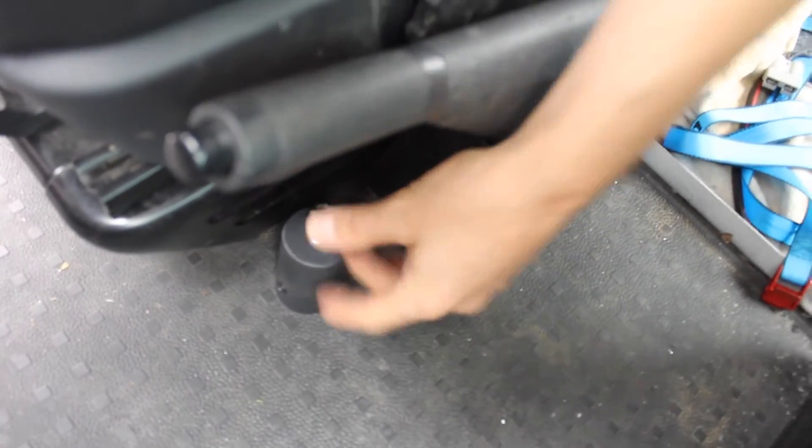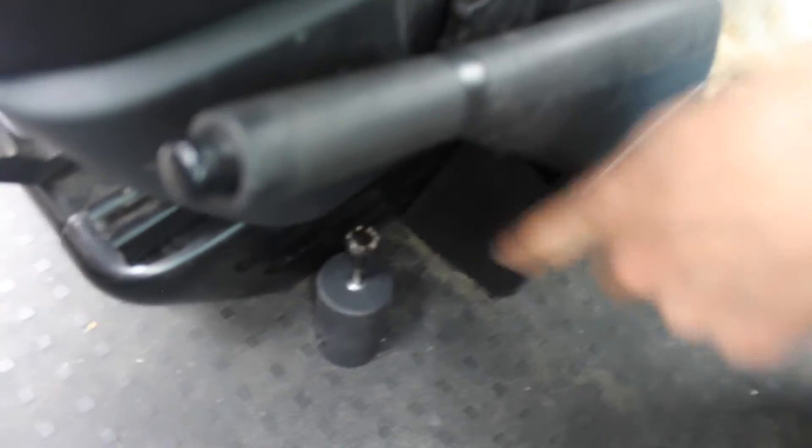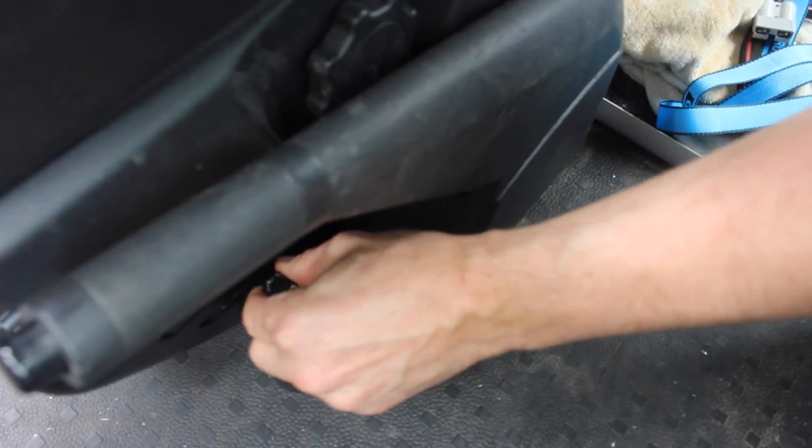Jumping into the interior — we have this little fella down here. As you would have seen in the videos, it's just a little choke cable he's put on. You pull it up and twist it, and it locks in. But you want to be moving a little bit so that it locks in properly, rather than grinding. Nice and easy, simple — which makes it perfect for anyone who wants to do the same swap. There seem to be lots of vans out there wanting a lockable rear diff, and this should hopefully help anybody who wants to do it. Any questions, just send them through. Thanks guys, I'll talk to you soon.